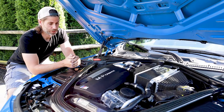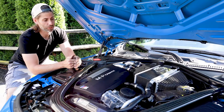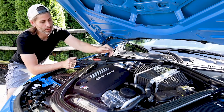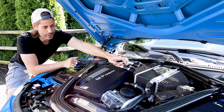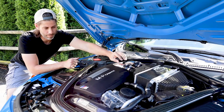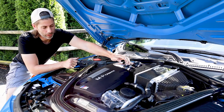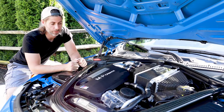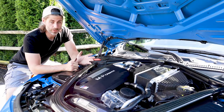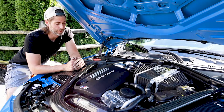The last thing would be engine cover fitment. When I initially went to put the engine cover back on, sure enough it did not fit. To fix it: loosen up the charge pipe side of the clamp to the intercooler, loosen this up, pull the pipe out maybe just a fraction of an inch, then push the entire pipe back while retightening. Once I did that, the engine cover fit on perfectly. They do note in the instructions that there's a tiny bit of wiggle room with both pipes in the event of engine cover fitment issues — that certainly was the case.